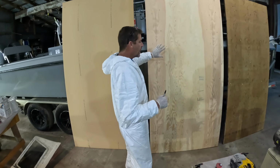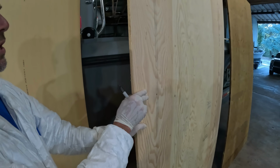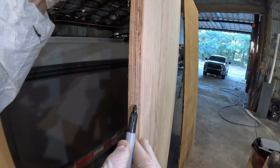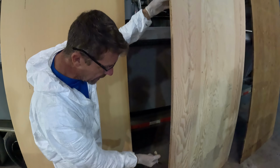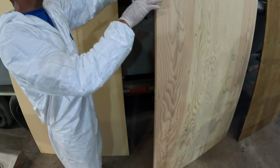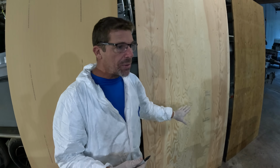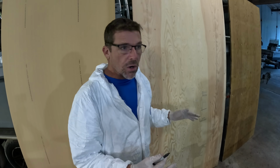So behind me, what I have is a quality Douglas fir marine plywood in 3/4 inch. If you look, you'll notice generally marine plywood is going to have more plies than your less expensive plywood. You can see that's 1, 2, 3, 4, 5, 6, 7 plies or veneers there. Also, if you notice down the edge, it is pretty much void of any kind of checks or holes or voids in the plies themselves. It's also going to be an exterior glue. It's going to have more plies, exterior glue, and we tend to prefer, or our family has always preferred, Douglas fir as typically the material.